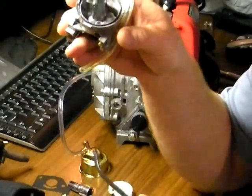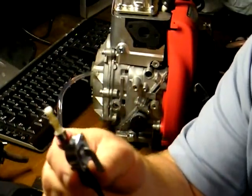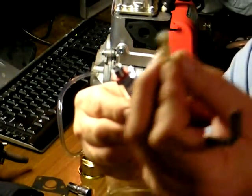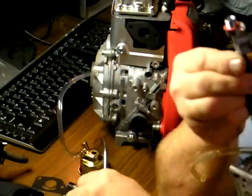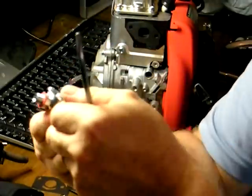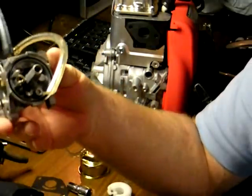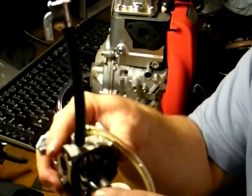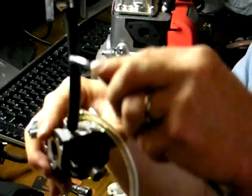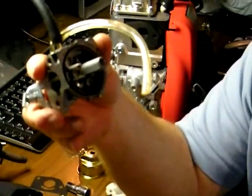Now you're going to take an air fitting. With your fuel line and fuel filter attached — note that the tank filter cannot be used as a filter for your carburetion system, so put that aside. Make sure your fuel valve is turned to the on position — crossways is off, and in-line with the fuel line is on. Take your air and spray it into the inlet where the little valve goes. Air will come through and blow the fuel line clean.